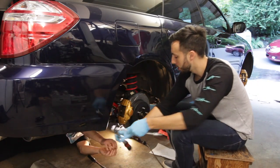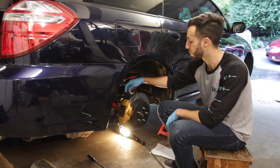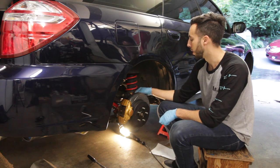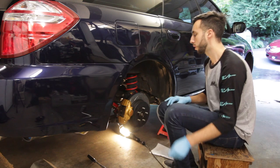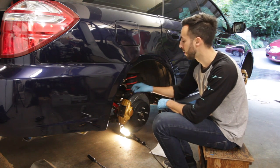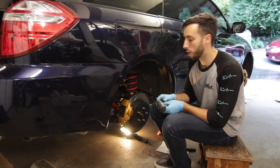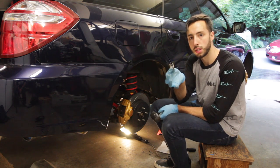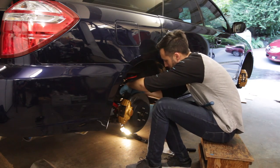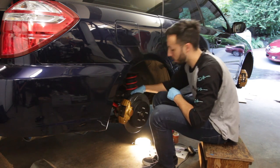We now have all the bolts torqued to spec and the brake is fully attached. The last thing to get this rear end buttoned up is hooking up the brake line. When we were detaching the rear brake line, we found it was easiest to unscrew the actual bracket that holds the brake line to the control arm, so that's still loose and will help when hooking up the new line. Make sure it's all sealed up tight — just go until it's snug; you obviously don't want to over-tighten it. Once the brake line is tightened back up and the bracket is reattached, use the little metal slide that goes against the bracket and the brake line to hold it in place — a rubber mallet will help tap that back into place.